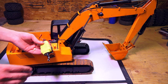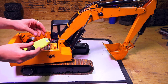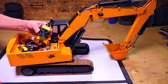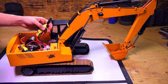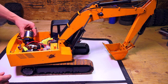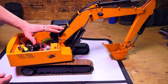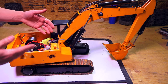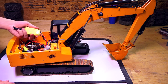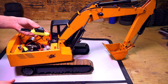This is the actual ESC — it's pretty big, it's 125 amps, which is large. The ESC basically takes the power from the battery, regulates it, and distributes it to the motor. So it's the brain — it's like the heart pumping the electricity through the whole machine. Now, this is a hydraulic unit. This is a hydraulic tank back here. This giant motor on the inside — it's like a helicopter motor — runs a pump and runs everything around. I've done a how-this-works video before. Today, I've got to swap out the ESC: 125 amps, two to seven S LiPo — blew it with some water in there. That was an expensive mistake.